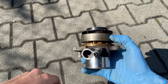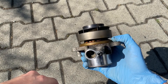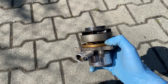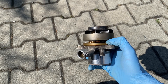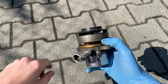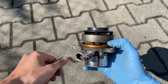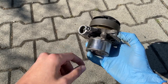It's a really cool design, but only if this element is working correctly. In my case I can see this is a little bit sticky, so it can get stuck in one of the positions. If it gets stuck in the down position, it's not that bad - your engine will just take a little longer to heat up. But if it gets stuck in the upper position, you basically have no water pump in your cooling system and your engine will overheat really fast, even though the pump is actually working.